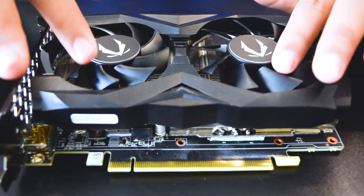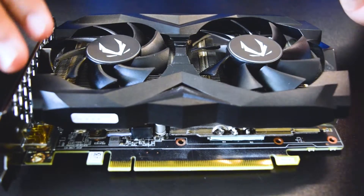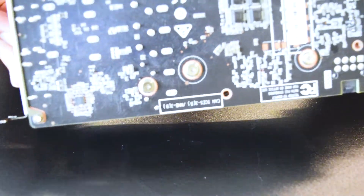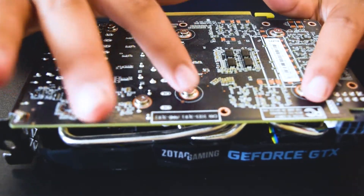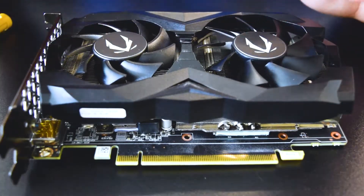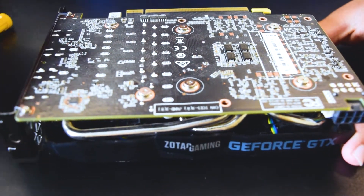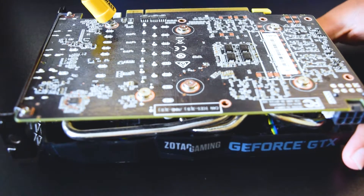So we have the 1660 Super right here. It doesn't seem to have a lot of dust on it — I just cleaned some out and there wasn't a lot, so that shouldn't have been the problem. Flipping this whole thing around, we can see a few screws. There are six screws on this GPU. In order to get the fan shell out, you have to remove all six screws at the bottom. These are all loaded with springs so you don't damage the GPU while screwing it back in.